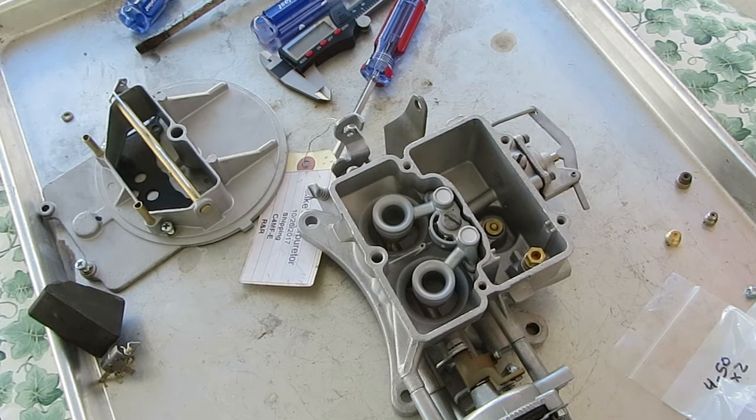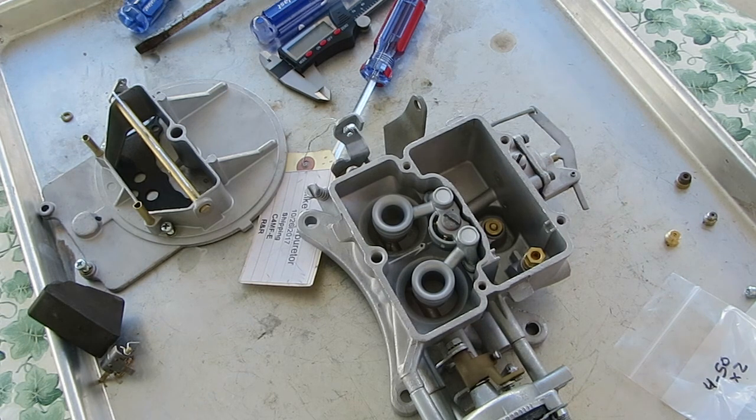It's very important that you get the size right or you ruin your engine. If you've been running the carburetor in your car for a long time and it's been working, and all of a sudden you're having black spark plugs, it's probably not the jets — it's probably something else. Jets don't change sizes in midstream. But if you picked up a carburetor from some other source and you haven't been running it, then you might have a problem. If you don't have the carburetor number, which often you don't on these 2 and 4 barrels, that's where you're going to have to start trial and error. Hope this helps you determine the right jet for your car. Thank you for watching.